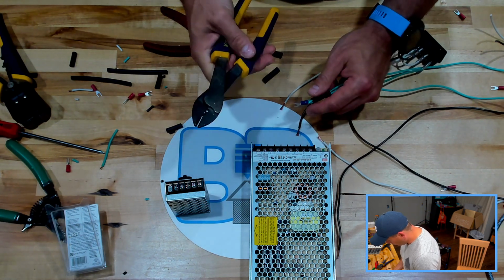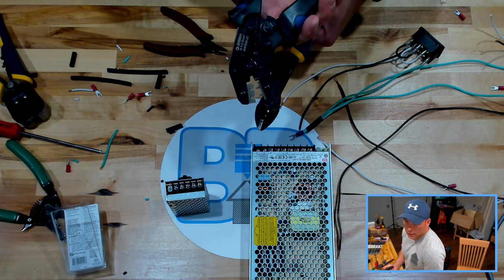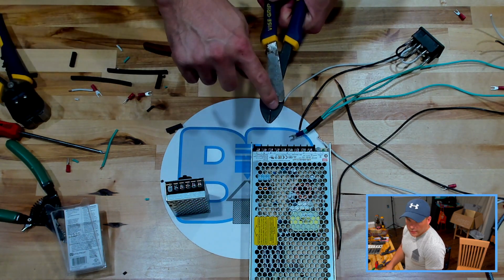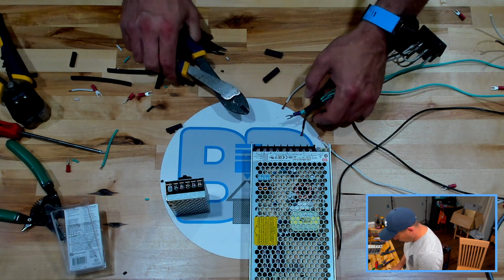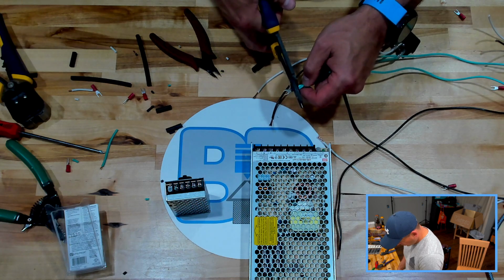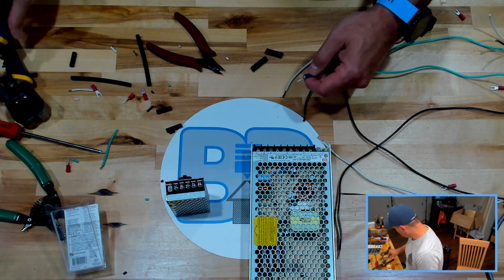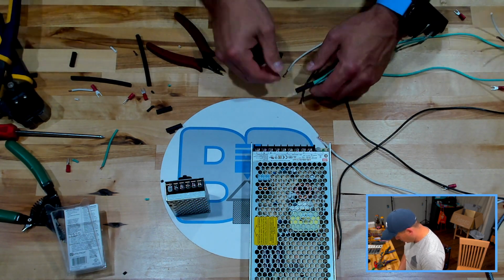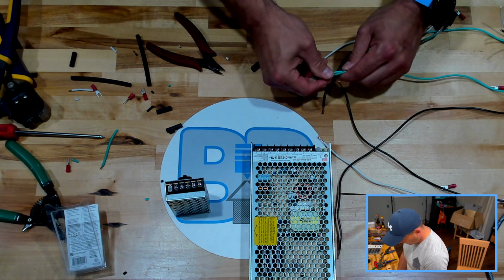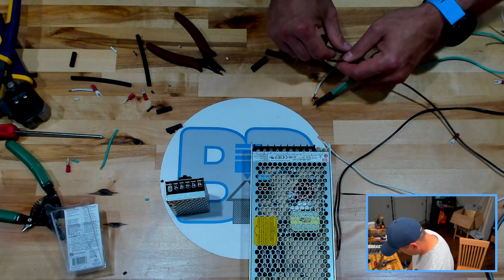Now for crimpers, I'm just using standard crimpers. These are very much like what you'd find for doing your JSTs and things like that. They're just much smaller. You basically have an end that fits into another end and causes them to push into each other, causing a pinch point or crimp. Unlike a smaller connection, the biggest difference is we're not crimping the wire and the conductor separately. It's all happening at one time. That piece of vinyl on the outside is kind of protecting the connection that we make.